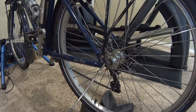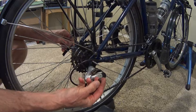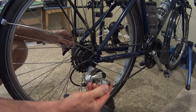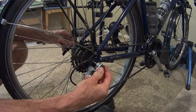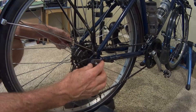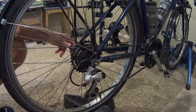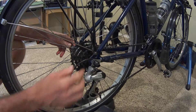Push this end through like that. Now on the other side, start putting the other parts on — first the spring with the small end first, then this piece that's already been put together, and screw that on the end of the skewer. Once you get it on that far, you can lock down the skewer. Then put the end piece on, and theoretically you're done.